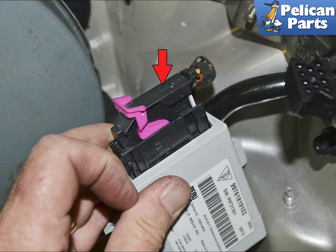If the control unit is replaced, it must be programmed with a PIWIS tester 9710, or if your scan tool is capable. It needs to know the relevant vehicle, country version, and equipment. Reconnect the battery, plug in your scan tool, and turn the ignition on. Select the special functions menu and erase all fault codes. Use the automatic search of control units, then select write in data and install the data readout. Your scan tool should display code write complete.